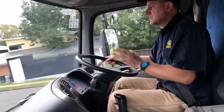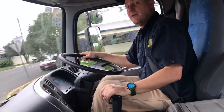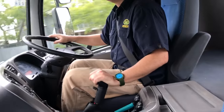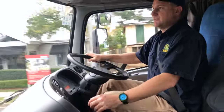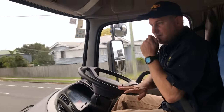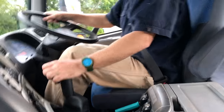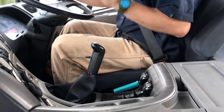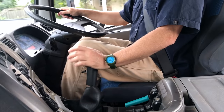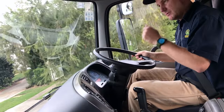Demonstrating going down the gears: slow the truck down, get the engine speed down, pop it to neutral, clutch to neutral, give it a rev, then clutch to gear. There's no great rush on timing — the timing that matters is when you give it the rev; clutch to gear just follows. Also notice I'm knocking the gear in, not sliding it — it's a punch in, punch out action.